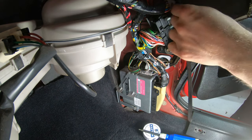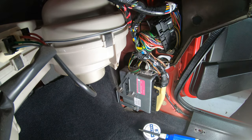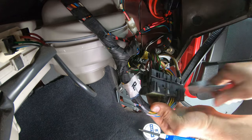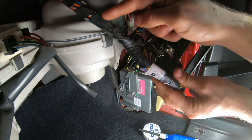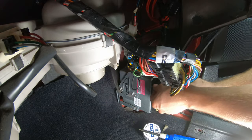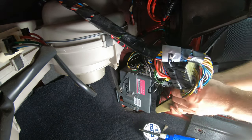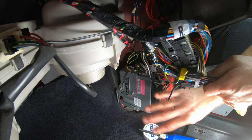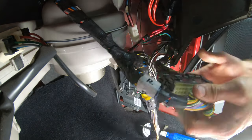Let's start with this one and get that out of here. I can see that this part right here goes into the engine bay, and that's obviously connected to the ECU - the engine management unit. We call this the fuel box because it handles only fuel. Then we have an ignition box on the driver's side up at the steering column - we're not going to worry about that now. We have this giant connector here and it's quite easy to disconnect - just two pins, push those in and you separate the whole thing.